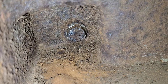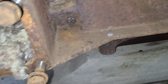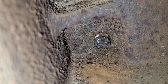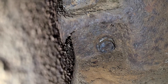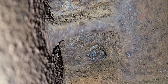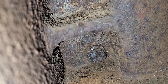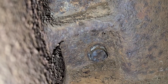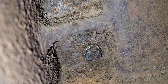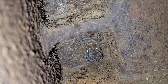For everyone who said everything's been coming out so smooth — this is the last bolt holding the front cover on. It's down low, right to the left of the pulley, and the 9/16ths spun on it. I went to a 14mm first — pounded it on with a hammer, it still spun. Went to a 13mm — that spun. Went to a half inch — that spun too. So since the bolt is shot, I'm just going to center punch it, drill the head out, get the front cover off, and then we'll be able to extract the stud after everything else is past it.